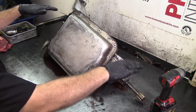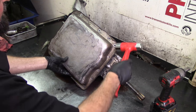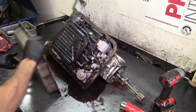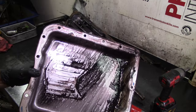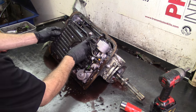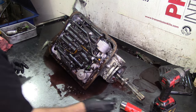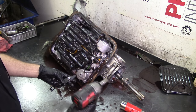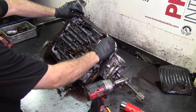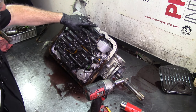Transmission benches have a drain in the back with a hole in the center — you put a five-gallon bucket underneath and all the fluid drains to the rear; they're on an angle. The bench is burned up. This truck is from the Houston area where there's a lot of flooding. And here's that missing pan bolt right there! I guess we can put that 10mm on there to make the outside look good. Basically it's a 13mm bolt you take off.